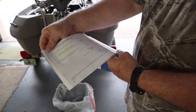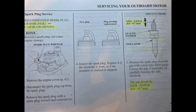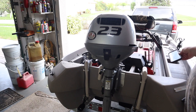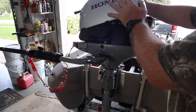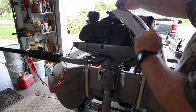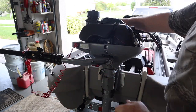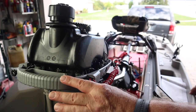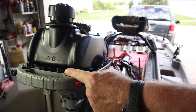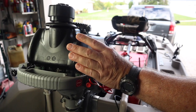This is the manual. Page 46 shows you a number of lubrication points on the motor as well as information about your spark plug. So let's do them one at a time. First we have to take off the cowling to the motor — pull down the rubber strap, lift this up. On this side there are two little tabs that come out. Now this doesn't come all the way off unless you untie this. Now some of the places I want to get into are right inside here. There's a throttle arm in there we need to lubricate, but the fuel tank is a little bit in the way so I'm going to pull it out of the way.